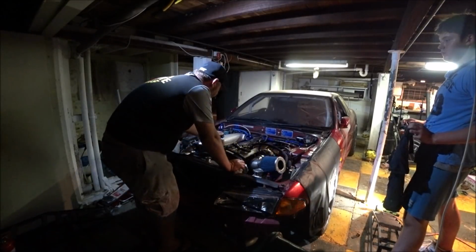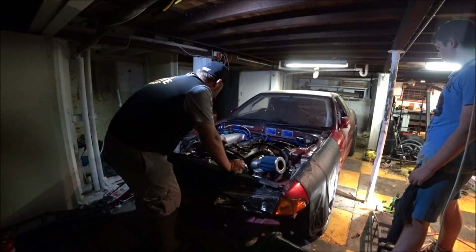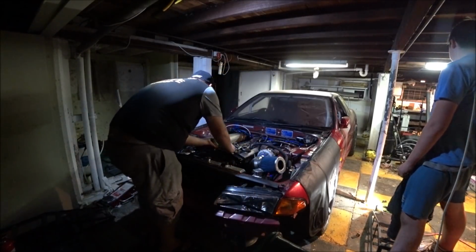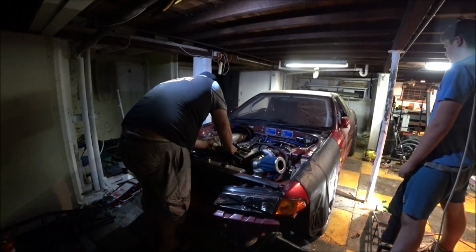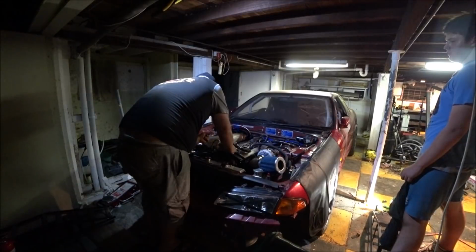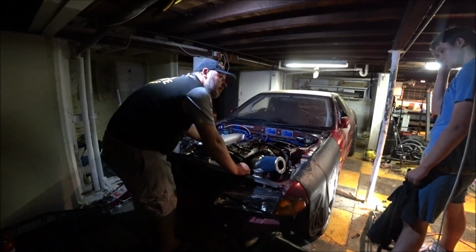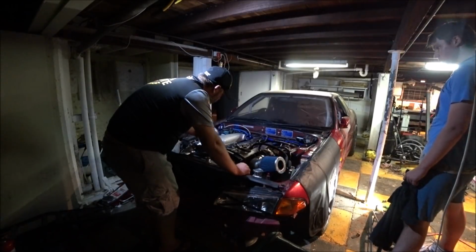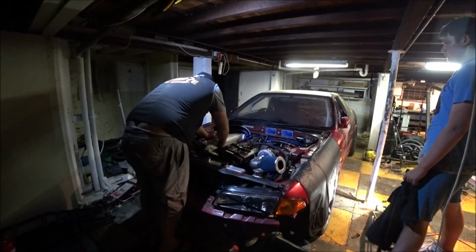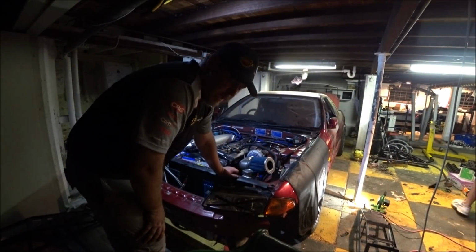So tomorrow we have to replace the fuel line. This one at least. And God, it's gotta be... Bottom end of that's way down there. I did that through the front. The radiator's gotta come out as well. Replace the radiator, replace the fuel hose, lots of other stuff. So tag two, gonna have to replace that fuel line.